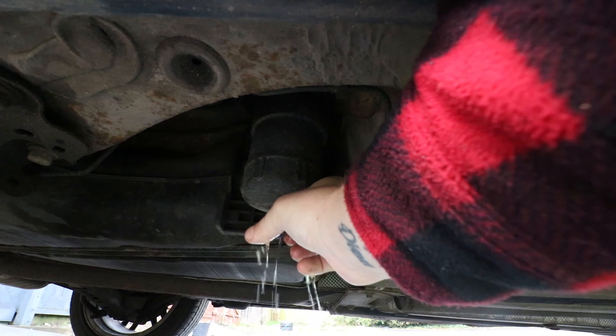What I ended up using was an oil filter wrench — just put that around the bottom part of the filter onto the raised edges and twisted it. It's really tight if it's been on there a while, so use something like that, a rubber wrench, or the proper tool. The new filter goes in with the nipple pointing upwards, and there's a gasket on the housing that you need to replace. Get a new gasket, put the new filter up in there, and re-tighten the housing — not as tight as it was, just give it a nip up.